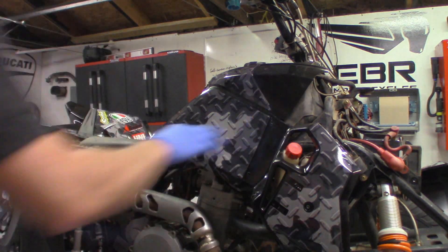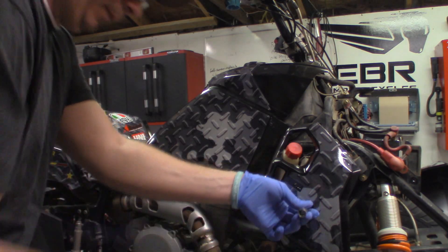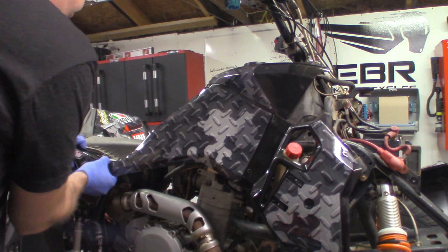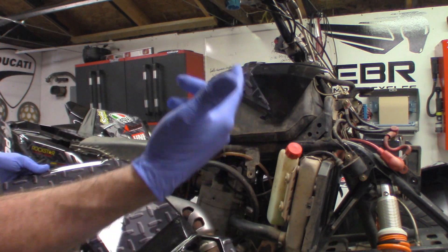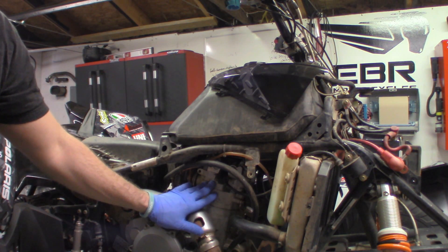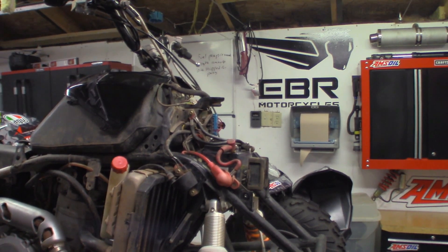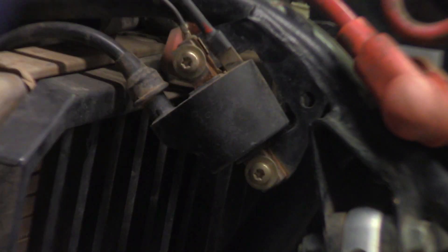To make this a little easier, we'll remove the side cover. When I first fired it up, it popped and gagged — I could tell this four-wheeler hadn't been run in quite a while. I'm running it every day now. When you go to change the spark plug, make sure the cylinder is cool, not hot to the touch, because we're dealing with aluminum. Look at the rust and corrosion on this coil — this thing has definitely seen some water, which is probably how that circuit breaker I pulled out got damaged too.